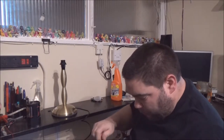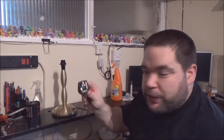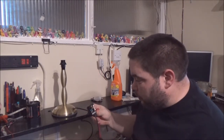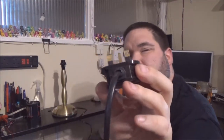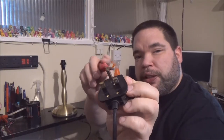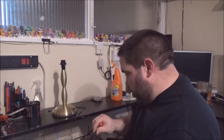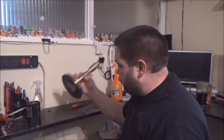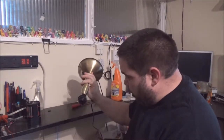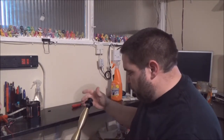The plug's alright — the plug's compliant. Got to make sure it's compliant. Three amp fuse as it should be. Wires are fine. Cord grip's fine. By compliant plug I mean it's got to have the insulated pins on live and neutral — the earth does not have the insulation on it. Just check the flex, make sure it hasn't got any damage. Inspect the unit itself — there's no cracks, no damage, nothing loose, apart from the screw for the lamp shade.